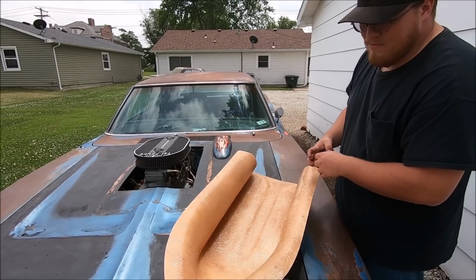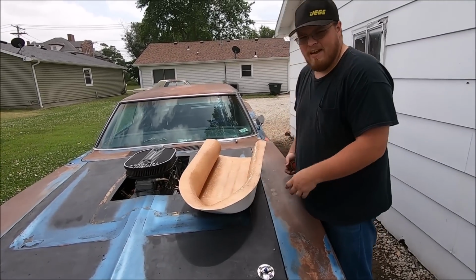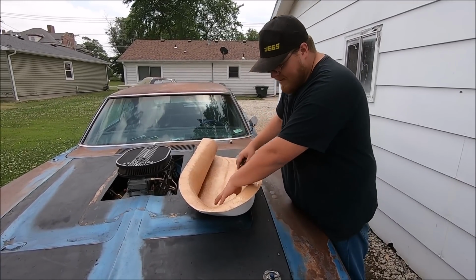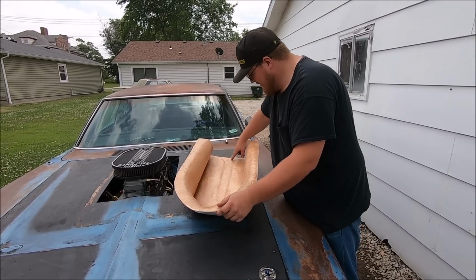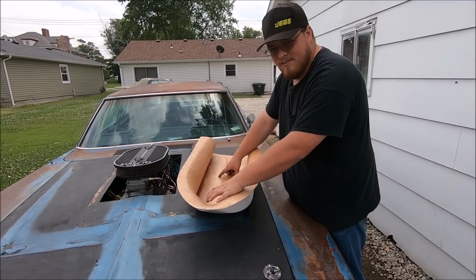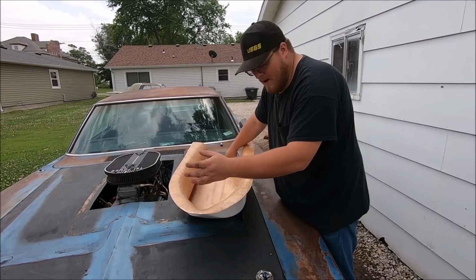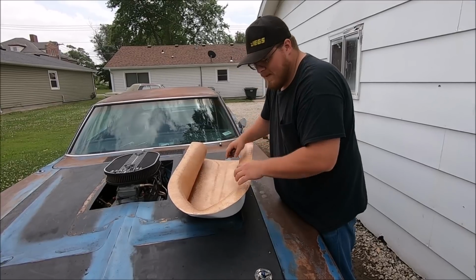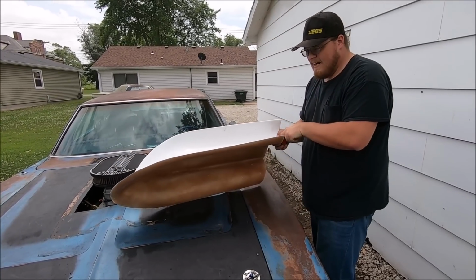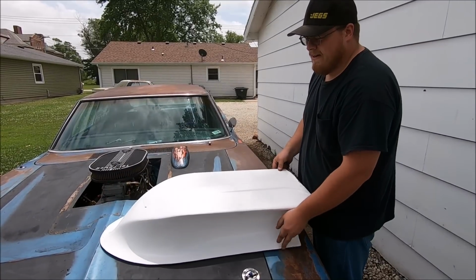You can fiberglass, but we're gonna make it look really super cool. We got some blue clear plexiglass that's 1/8 inch thick. First we're gonna form the plexiglass to this shape, then slice it down the middle and add about a 5-inch strip, which will actually be 6 or 7 inches, so we've got a flange on the inside to panel bond and adhere it to the fiberglass. Then the super cool happens when we cut the sides out and put plexiglass in there as well. There won't be much scoop left, but I think it'll look really sweet.